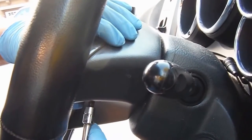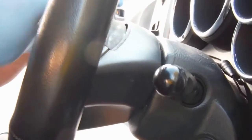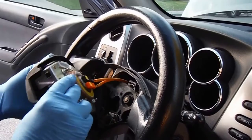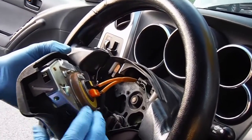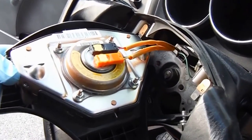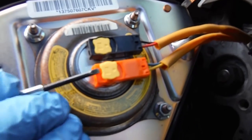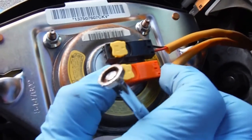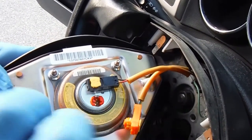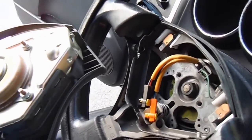You may have to pull outward just a little bit on this plastic part. Then you can remove the airbag and we need to disconnect these two little clips. You can do that just by pulling out these little yellow inserts — you just lift them up and then these will come out. Just pry them out and then we can set that aside.